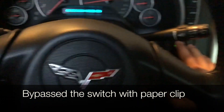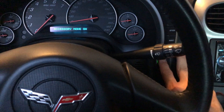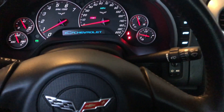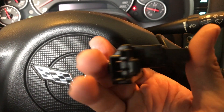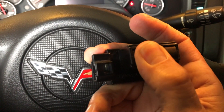And now it will start — let's not start it up with this on, let's go out of accessory mode, and boom, there we go. After my car was sitting for about a month I was finally able to figure it out, so it cost me $300 to buy this tool but I'm happy I figured out what the problem is. This is the sensor I believe to be faulty — it's the sensor that shows the clutch is fully depressed; when you push the clutch in, it contacts right here and pushes it all the way in. It kind of stinks I had to buy this tool to figure it out, but I'm glad I didn't have to take it to the dealer.